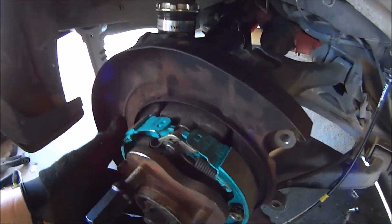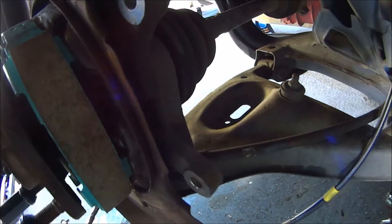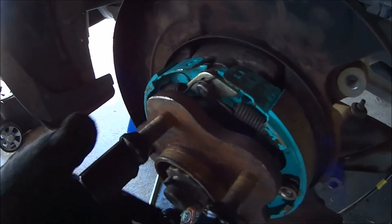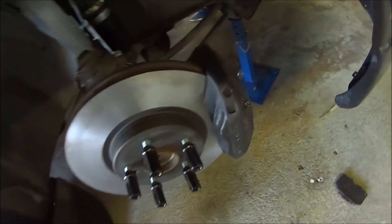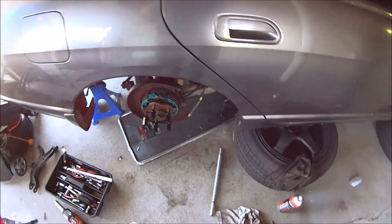I'm also going to put some of this grease on the backside of these rubbing plates where the drums sit, to protect them. Also put a little bit on the front pads — take the front pads out and put some on the backside of the pad. That's the right thing to do. It's high temperature grease as well. That should stop squeaky, vibrationy, noisy things — or at least help.